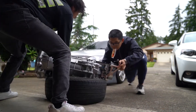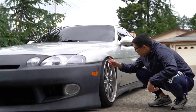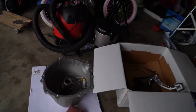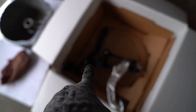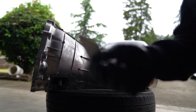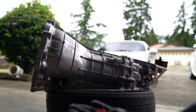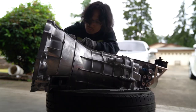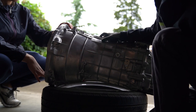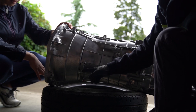This thing weighs so much. I'm gonna go ahead and start prepping the CD009, and then later the single clutch pedal and the smaller brake pedal. In this kit it comes with two metal pieces so you can draw your cutting lines — one for the bell housing and one for the input shaft. It also comes with little red caps to cover up all the breather holes. Since this CD009 is a six-speed it's super big, so we're gonna cut this little nub off so it's able to fit into the SC's smaller trans tunnel.